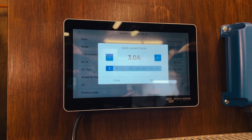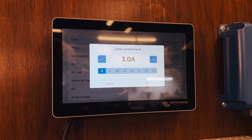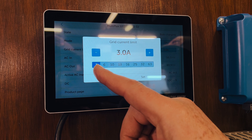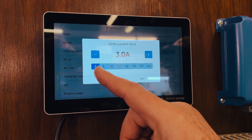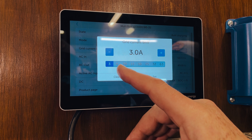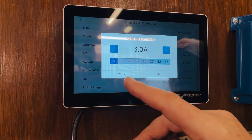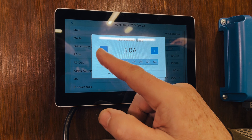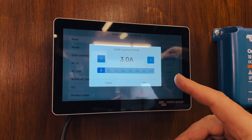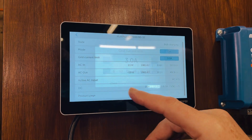For those who don't know, one of the really nice things about the multi-plus is that you can set a grid current limit. So let's say you're on a dodgy campsite with three splitters on the bollard already — you don't want to overload things. You could go as low as 3 amps, which is a very low draw, basically trickle charging your battery. As you need more power, the multi-plus will then draw from the battery as well. The most common is to set it at 6 amps, as there are a number of sites that have MCBs rated at 6 amps for each pitch. Because we are running this through the big multi-plus, we've gone to 3 amps just to basically trickle the battery. So you can set that and close it.